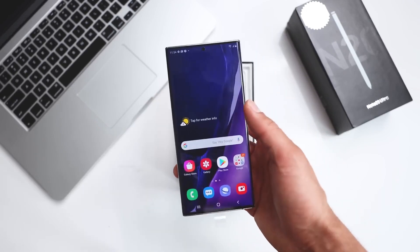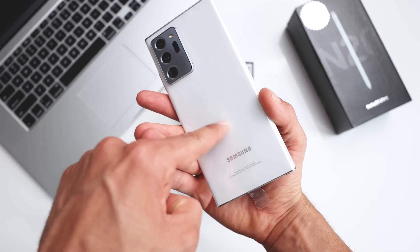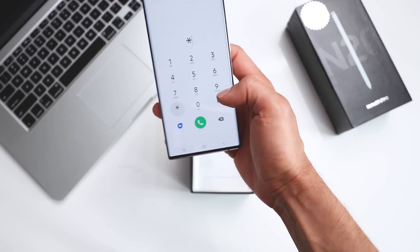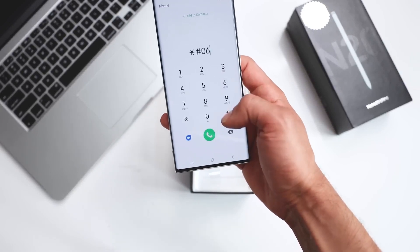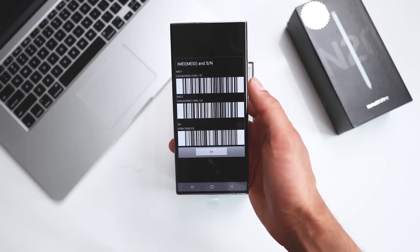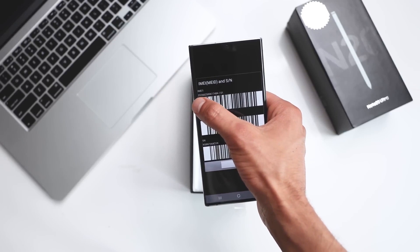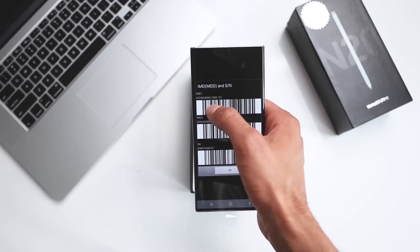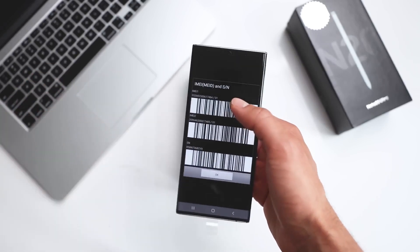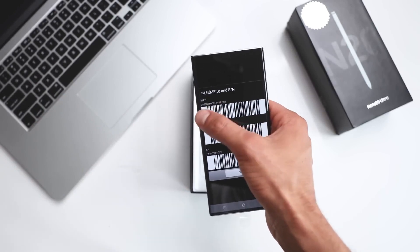The first thing you have to do is get your phone's IMEI number. Sometimes you have it written on the back part of your phone, but you can also dial *#06# and your IMEI number will show up on the screen. We're going to use only the first 15 digits, so keep this number handy because we're going to need it in a few seconds. The next step will take place on the computer, so put your phone away but keep that number close.